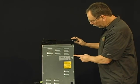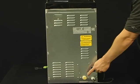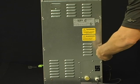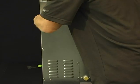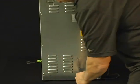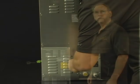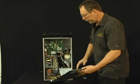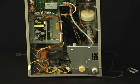So what we want to do now is remove the back panel of the machine. Just remember, you just got to loosen those screws that are around the teardrop openings, and then lift the panel off, and then we'll hook up our water line to the regulator. So now that we've loosened the screws, we're going to go ahead and lift the panel up and off the back of the machine. And just like your other machines, there's a green-yellow ground wire. Pull that clip off and then set the back panel off to the side.